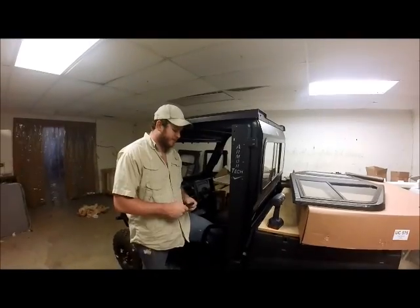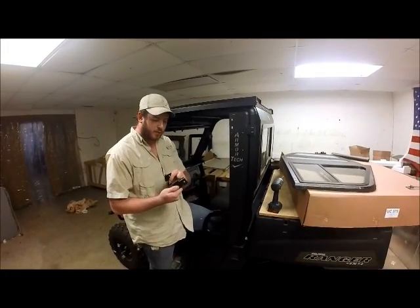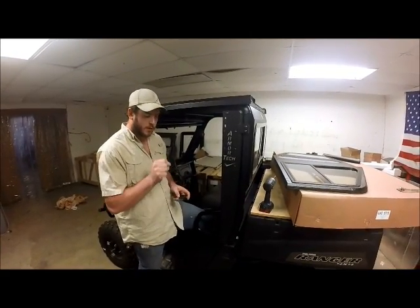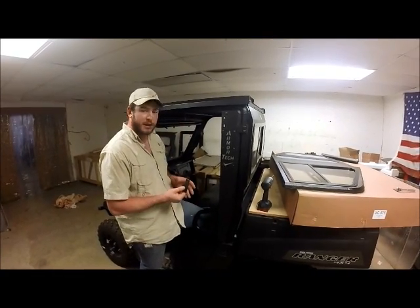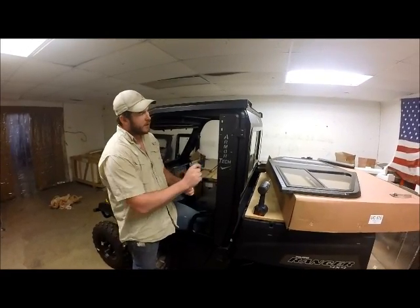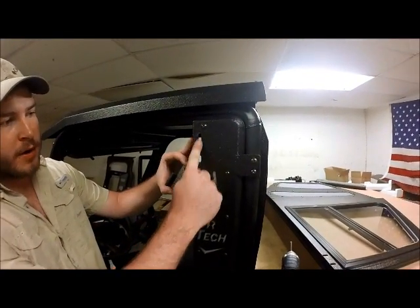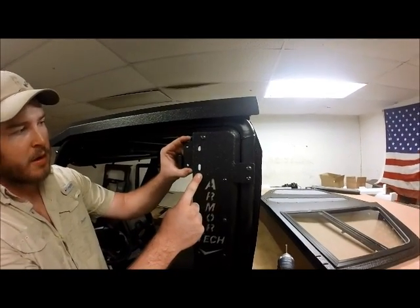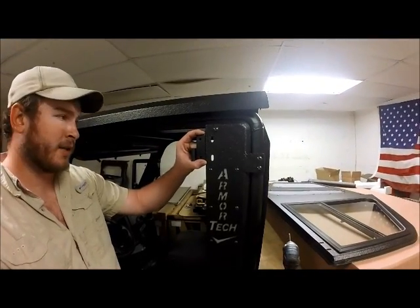We've got our hinges here. It's just a simple little door hinge. We got our male end with our prong, and our female. Our male end will mount on our door going downwards. We'll set that to the side for now, and we'll take our female end with the open half facing upwards, and it will mount to our jam. I'll note that we have vertical adjustment in these holes here. They're oblong shaped for any type of adjustment we may need later on when allowing our door to hinge correctly.